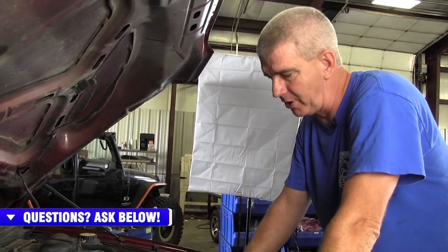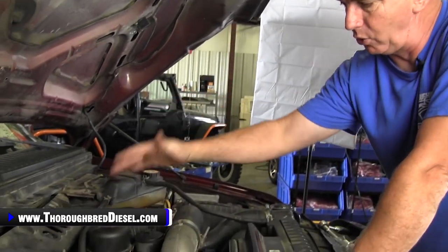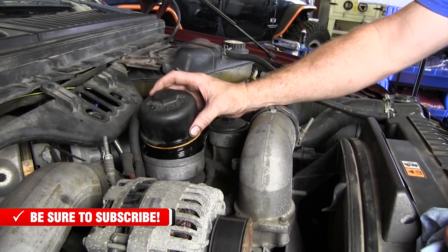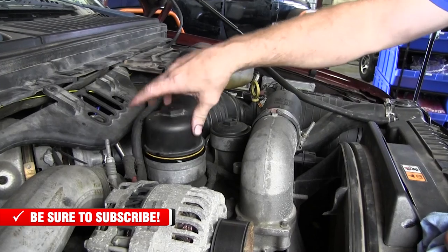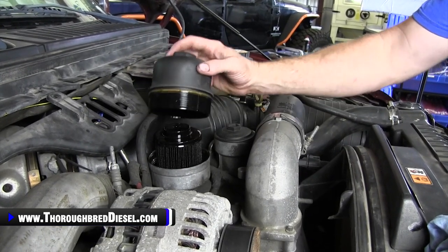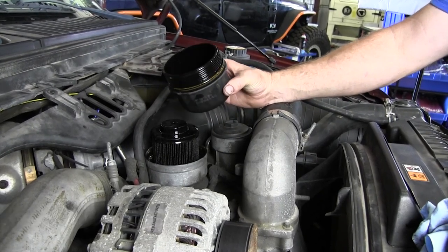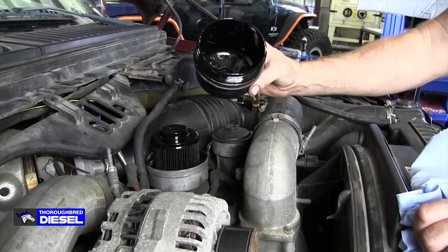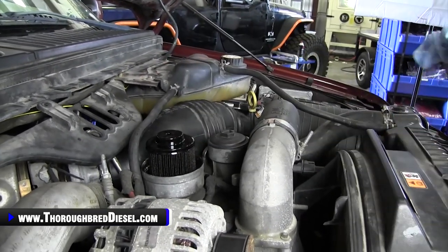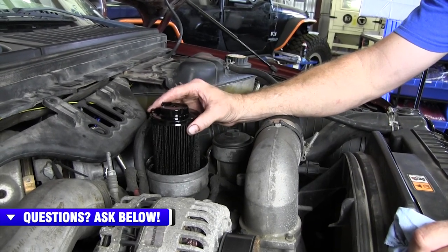Adam and I were standing here talking about this situation with these oil filters and just how kind of ridiculous it is. I went to take the oil cap off and was going to allow my oil canister to drain. This truck has one of the aftermarket oil caps on it — it says 'do not reuse cap' right on the top of it in big old letters. I went to take the cap off and the filter didn't come with it. As I was pulling it up, we're staring down the barrel of these guys having used the stock Motorcraft filter back in here. How in the world did this truck survive? Inside of that cap, it's got catches on it, but with the filter falling down out of the cap, I'm not too sure that the alignment was correct on the drain valve for this canister.